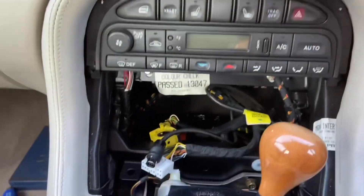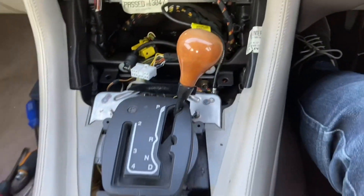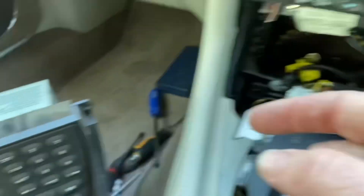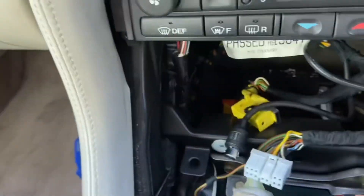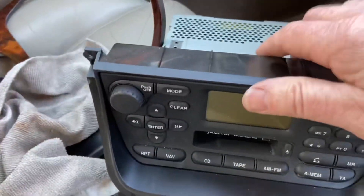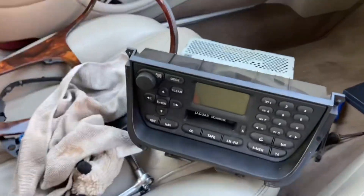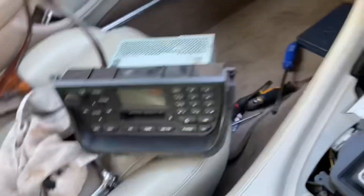With a bit of waggling around - very tight fit - I had to move the gear lever back into drive and then literally wiggle the unit out. It was a very tight fit on both sides. You can see there are lugs here and on that side, so just be careful when taking the set out that you don't mark the leather on the side. And obviously that's my air conditioning unit, so hopefully everything will go back in there again.